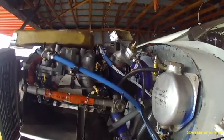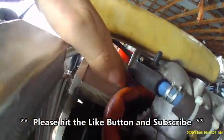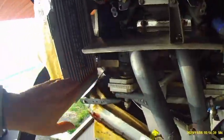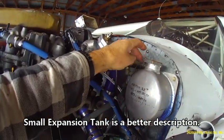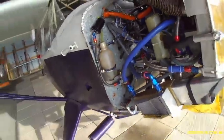There's an air bleed intended to get air out of the block, and there's another point where I take air out from the highest point in the block — feeding it back into this catch can. There's one more from the top of the radiator, the highest point. Water is pushed up the radiator and back down into the engine, so any trapped air bleeds out here back into the catch can. Because it has a pressure cap, as pressure builds the cap relieves it and lets air or glycol overflow into the catch bottle. That's how the coolant system works.